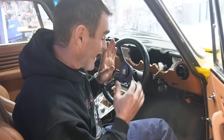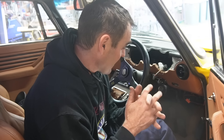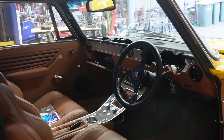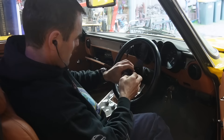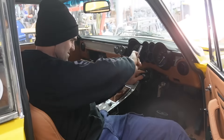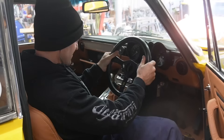The power steering — I can hear the module switching on, but I'm not sure whether it's actually doing anything since I'm not driving the car, so I'll have to physically go out and test it later. Spoiler alert: I don't get the power steering working. I'm now working on the horn — the issue is the spring tab I made in a previous episode is not actually touching the ring on the bottom of the boss kit. I just needed to space it out with a plastic washer, and now I have a working horn.